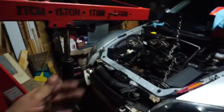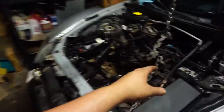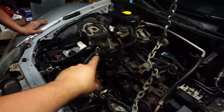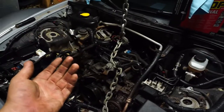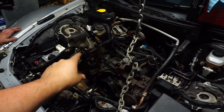Okay, we pulled off the entire exhaust because that seemed to be easier. We took off the engine mount bolts on here, just the 3 on the aluminum part, and on that side we took off the bushing on the frame, and then the mount itself. We jacked up the engine, jacked up the transmission, started prying it apart, and eventually we got that whole mount to fall out.